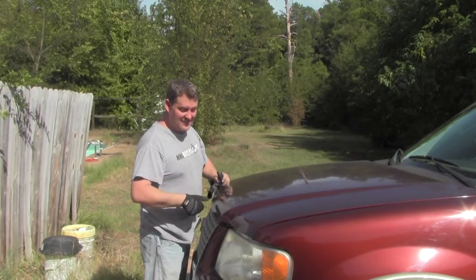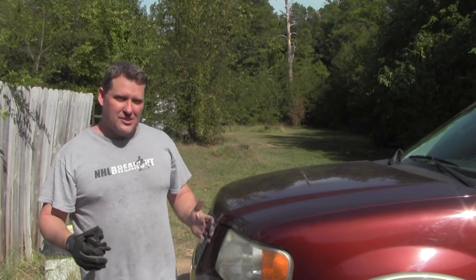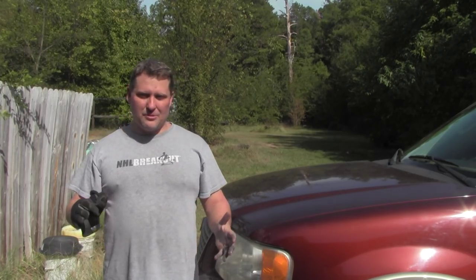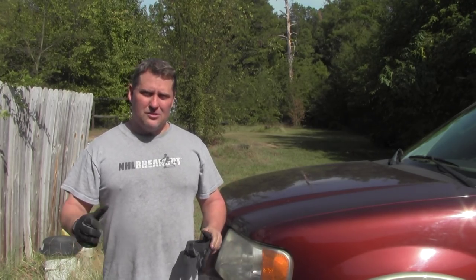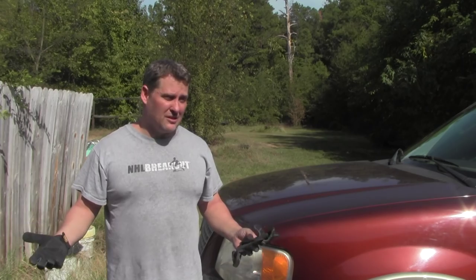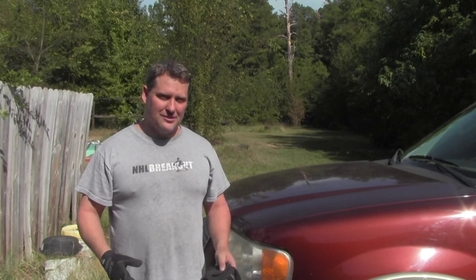Well, that wraps that up. One of the cool things about this particular job is I had no prep for this. Christian called me, he was having a problem with his truck. We got together, and between the two of us, we kind of brainstormed the problem. Ultimately, it ended up being the motor that operates the throttle body. We swapped that out with a kit. It was a pretty straightforward fix. Anybody could really do that. It was about $50 and a few hours worth of work. A lot of that time, real time on these fixes, is like a half hour, 45-minute fix. We're moving cameras around and doing all our thing, so that adds to the process. But in the end, this is definitely something anybody could do.